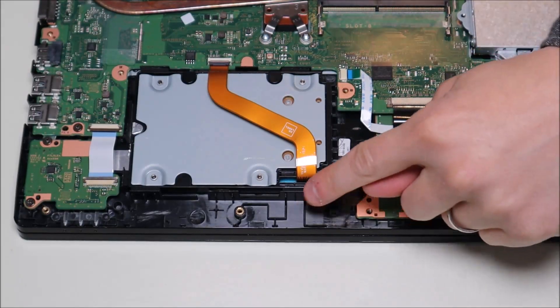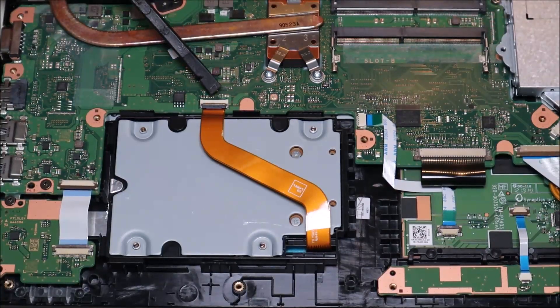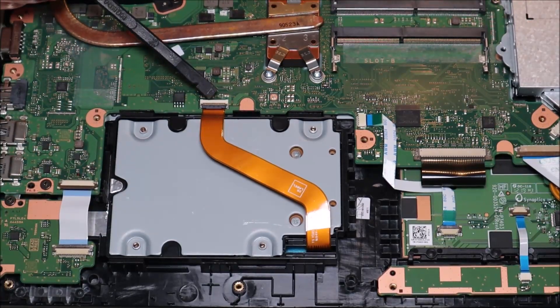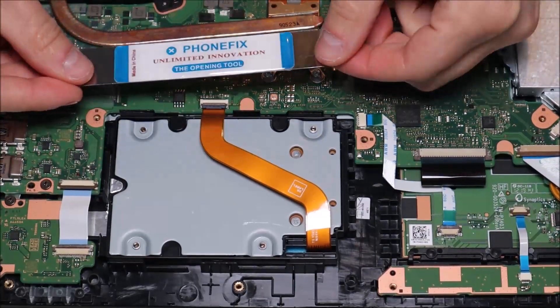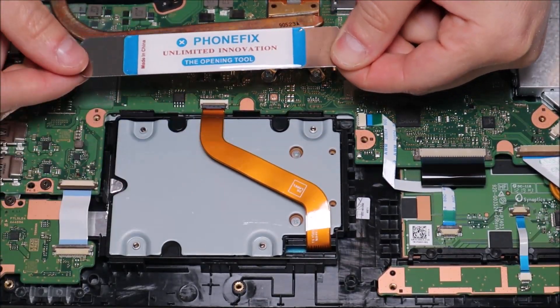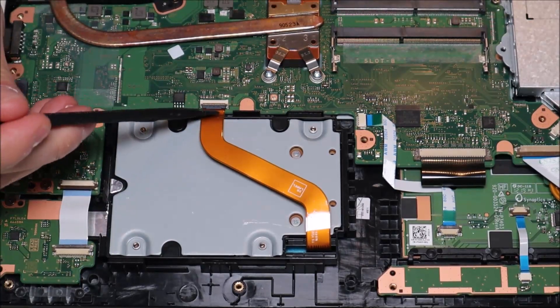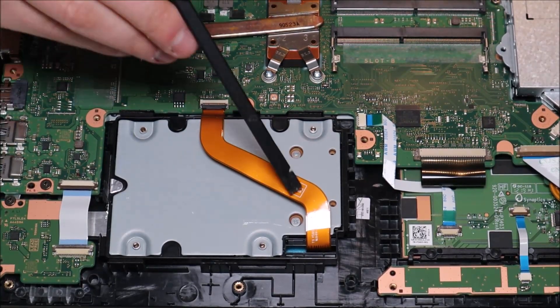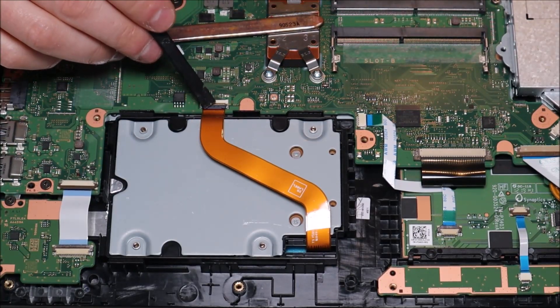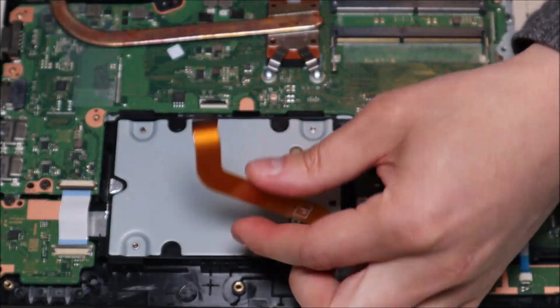This is the inside of your computer. There's your solid state drive assembly box right there — it's plugged in by a ribbon cable that goes into your motherboard. There's a white port on the motherboard; the ribbon cable comes in and there's a black clip that slides over the ribbon cable to fasten it down. To release the ribbon cable, you pop that clip up and then slide the ribbon cable out. Be very careful — these black clips are very breakable and if you break one it's almost impossible to find a replacement, so your ribbon cable won't be able to attach securely again.